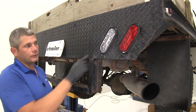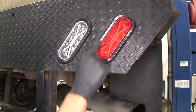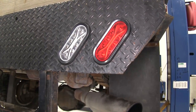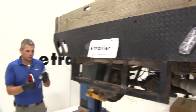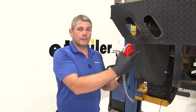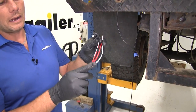If you take a look here at the passenger side, you can see we've already got these installed. We've got our rubber grommet here — our reverse is here closer to the middle, and stop, turn, and tail light going to be closer to the outside, also in a rubber grommet. We're doing these together because we're going to ground the plugs that go in the back of the light together as they go over to the actual frame, so we just have one good big ground point.